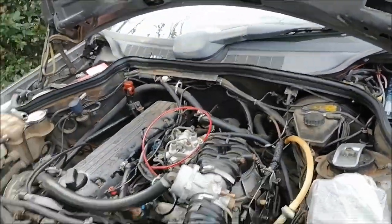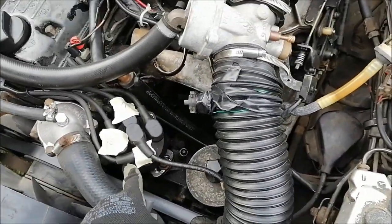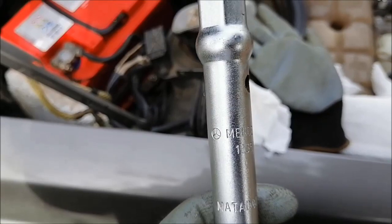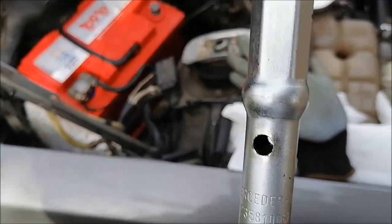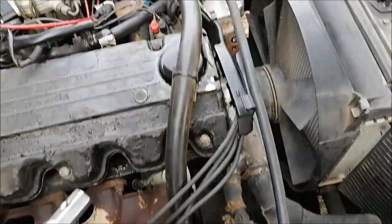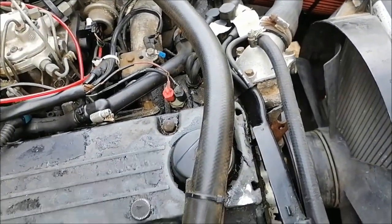Hello YouTube. Today we changed the ignition system — the wires, the distributor cap, and the rotor arm. I check my spark plugs and remove them. Because this Mercedes is going to run on LPG, we put back the spark plug. Every time you put back the spark plug, use the rubber for torque. I use the original Mercedes-Benz tool — you can see the part number — and I tighten just by hand, as the manufacturer recommends. Now we go to remove the old cable and the rotor cap arm.